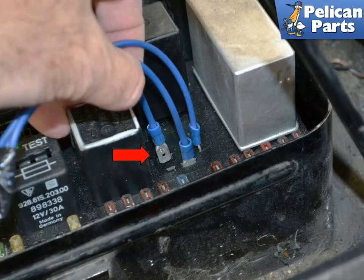You can bypass the relay for testing purposes to eliminate it completely from your troubleshooting list. Use three pieces of 14-gauge wire along with three male spade connectors. Note: this should only be used to test or in an absolute emergency situation — do not regularly drive your car with this in place. Connect a spade to the end of each wire, then join the other ends together, making sure the junction is safely attached and protected.